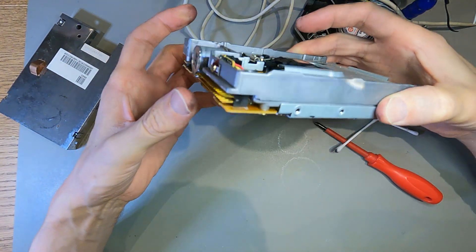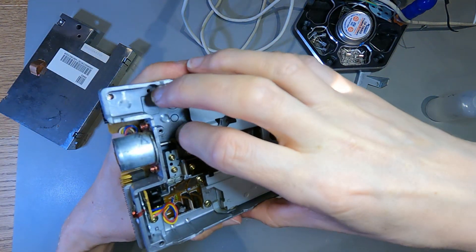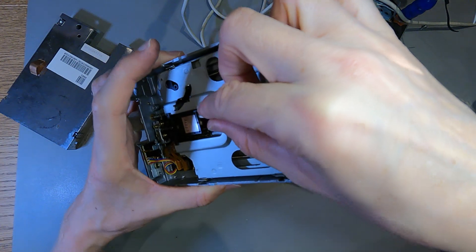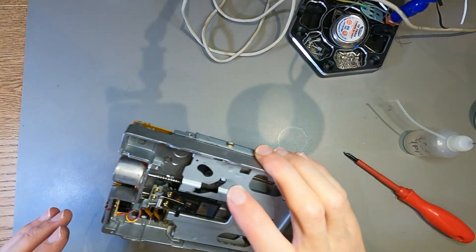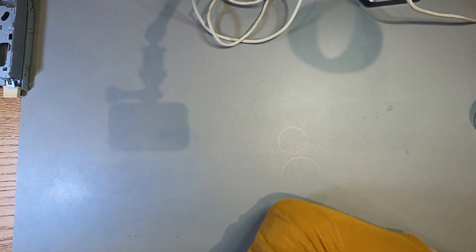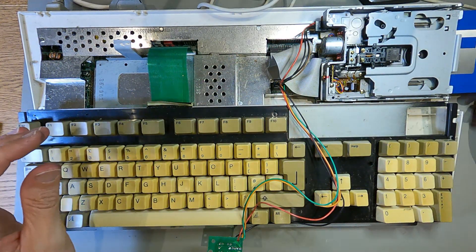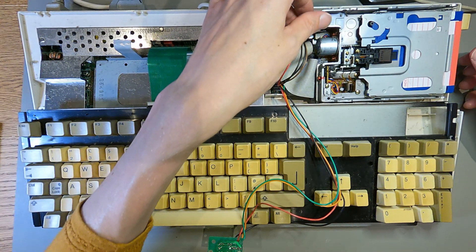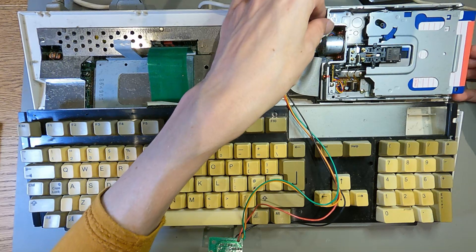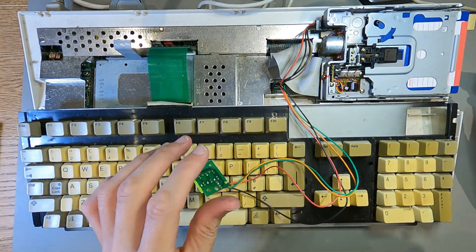It's also got three electrolytic caps that I can see. They could be gone - that was the problem with the last drive, which had bad electrolytic caps, but they were surface mount ones. These ones don't quite look as bad. Just give the heads a little clean in case it decides it wants to read a disc. Let's try that and see if that's changed anything. I've just cleaned some grease - I don't think that's going to make any difference, but you never know. The computer's on - that's exactly the same. It should be trying to move that worm drive. There's it spinning the disc, and it can't do anything. It's not even attempting to move that.